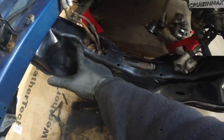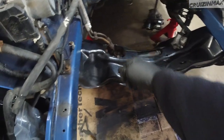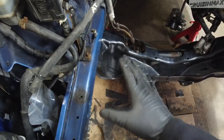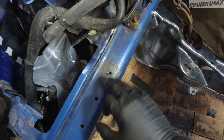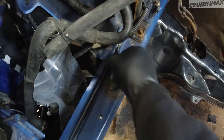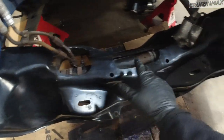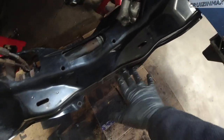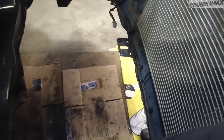Not the whole thing, just spots where the rust is. That's why I was using the wire brush. And the rust, we're only getting rid of the flakes. Okay, like this is good. We can see some metal, and this is also good. No more rust is coming off even with my fingers. And we're gonna treat everything where there is rust, especially this area right over here,